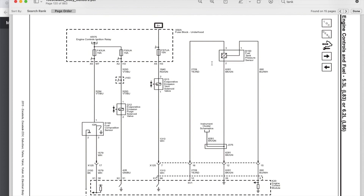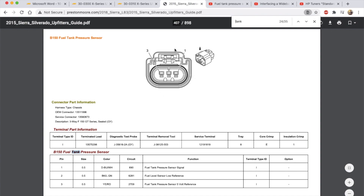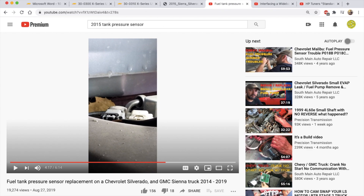Don't worry about the yellow and red — pin 3 on the fuel tank sensor is a five-volt signal; do not hook anything up to that. This is the connector connected to the fuel tank pressure sensor on top of the fuel tank. In this picture of the top of the fuel tank with the bed removed, you can see the fuel tank pressure sensor and the connector for the fuel pump and level indicator. That one has a locking tab — you can't unplug it without releasing it. The pressure sensor connector you can just reach in, hit the tab, unplug it, and pull the pigtail down between the tank and the driveshaft to inject your signal there.